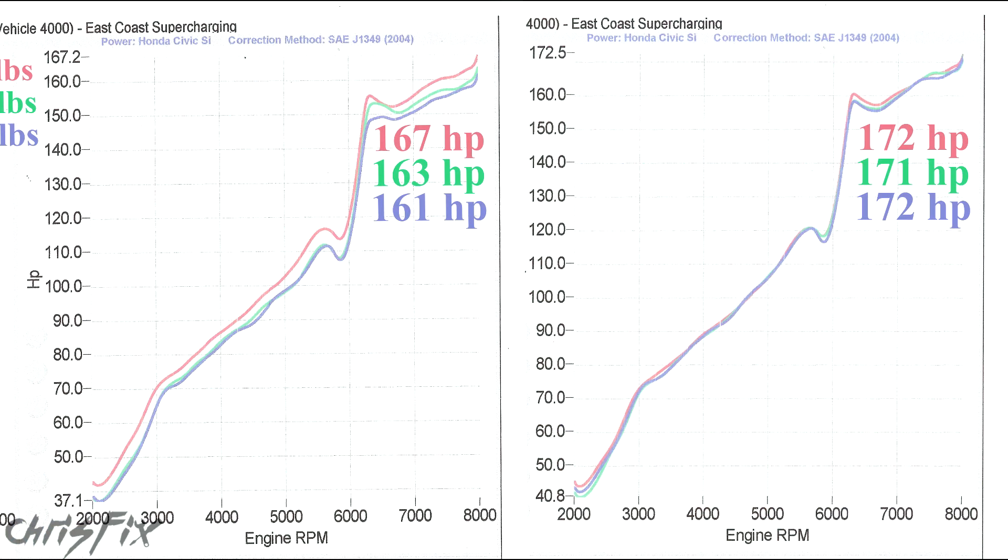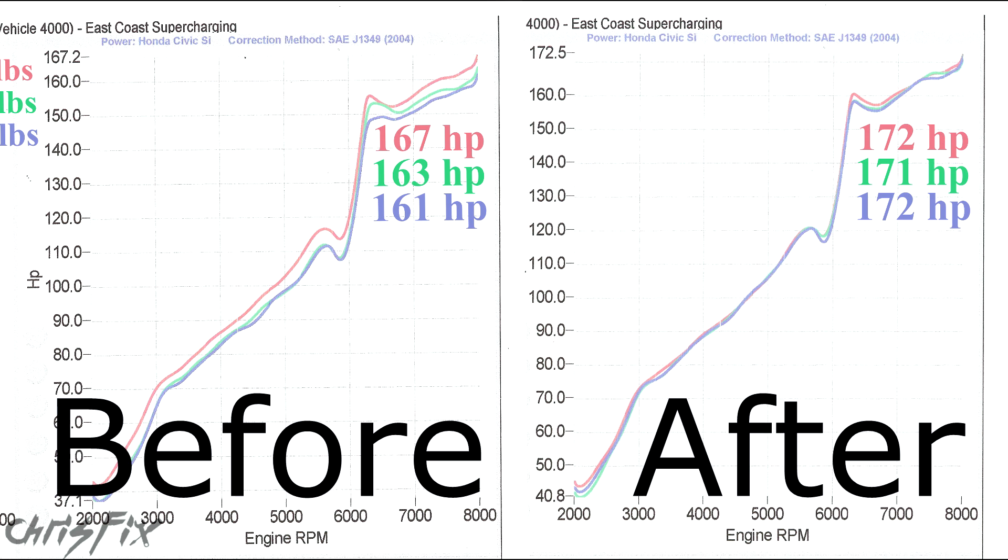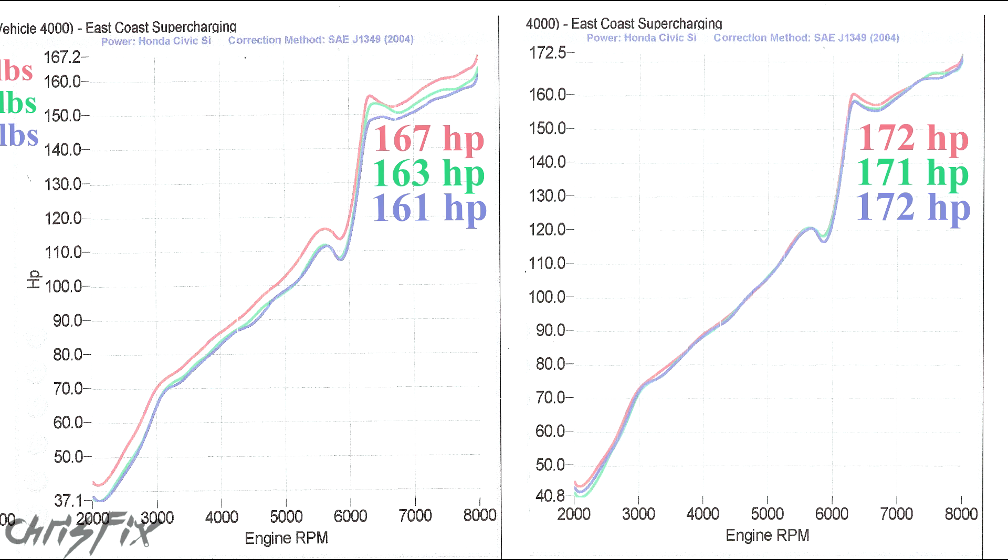Let's do a comparison of the horsepower numbers from our baseline before we added the fuel supplement to after we added it. The before is on the left and the after is on the right. The horsepower curve looks interesting because the engine has VTEC, which changes the lift of the cam and the timing to give you more power — you can actually see where the power would normally drop off, but then VTEC kicks in and you get a good amount more power. In the before graph, the highest horsepower was 167 and the lowest was 161. For the after, the highest is 172 horsepower, and unlike the other graph, these runs were way more consistent. Even on the third run with Clean Boost Max, the car is still making 172 horsepower compared to before where it just dropped off.